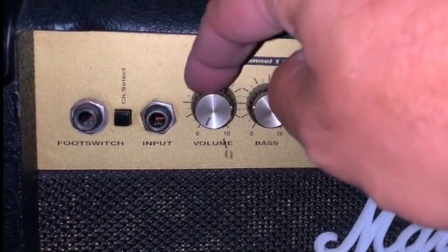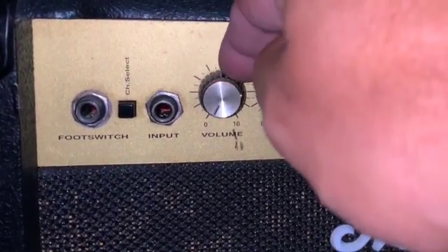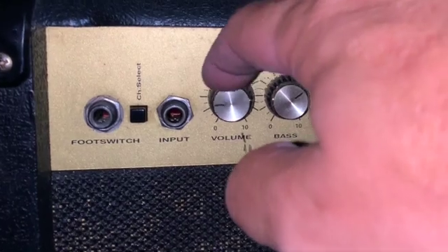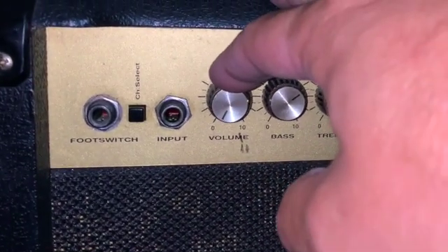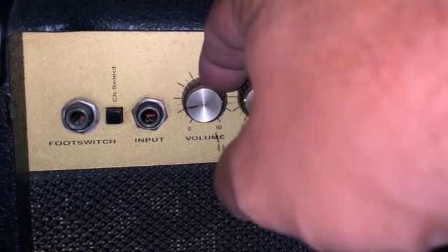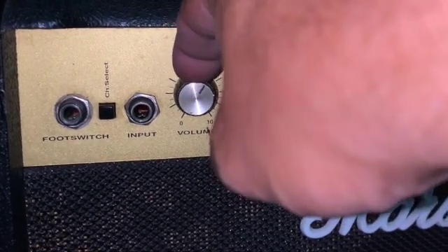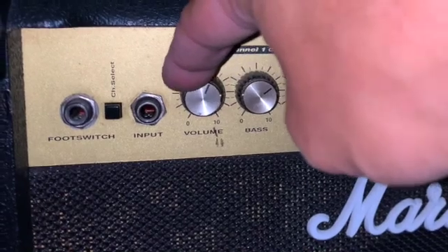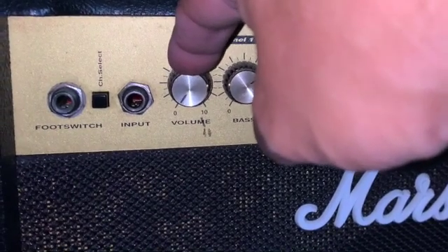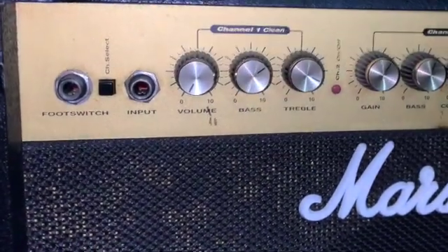If this were your throttle pedal on the EV, to attain maximum throttle you would have to get it up to full travel as fast as you can. What the throttle controller is doing is taking that full range — like going to 11 — and putting it at about 3 or 4, depending on what setting you have it on. So instead of you having to go all the way to the top, you only have to go partway and you're achieving max wide open throttle. Now this leaves the rest of the pedal travel pretty much dead — depending on what setting you are on, the remaining pedal will be numb because you're already at max throttle. That's why the throttle controller makes the car so easy and responsive to drive.